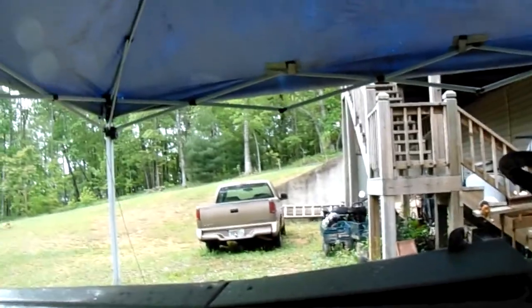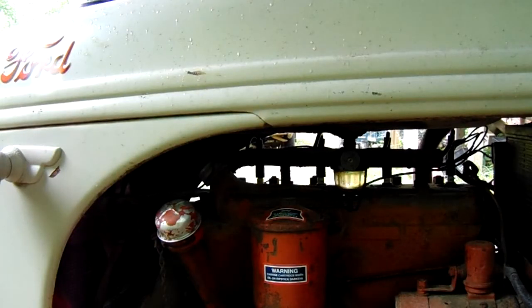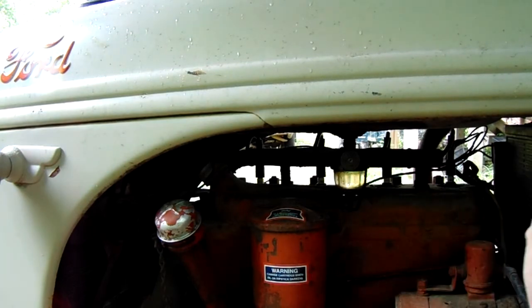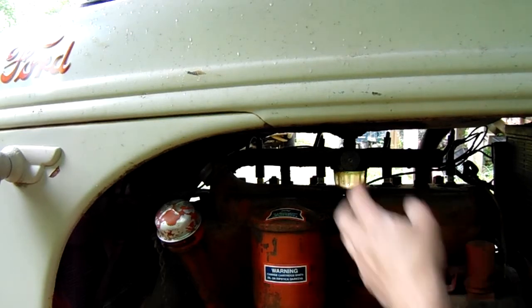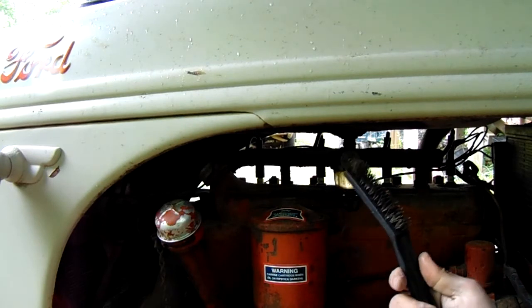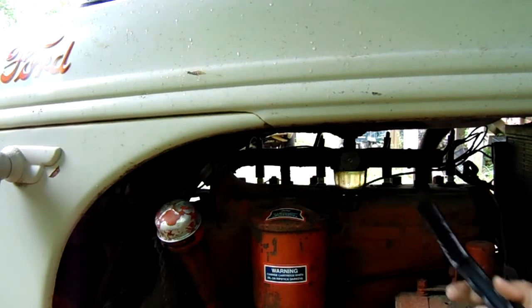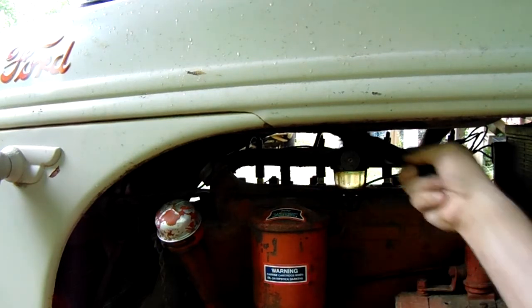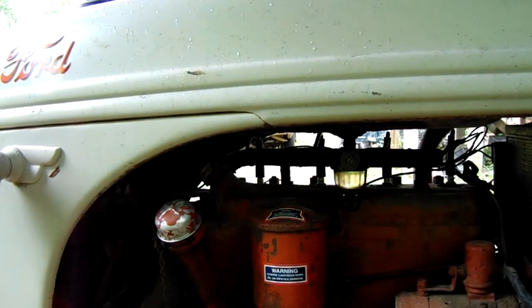Let's just get back on it. We got a bucket sitting under this thing to catch any gas, and we're going to have some gas come out of this. It protrudes up in the tank a little bit, and there's just no way to drain every last bit, even on reserve. So we got a bucket to catch the gas, and it's important that this is not the same bucket you caught your gas in that you're going to reuse, because we've cleaned with a brush here. We've cleaned all this area, got as much trash as we can. These tractors are old, and there's still a lot of trash here. We've cleaned this just to make sure we don't get trash back up in the tank when we put the new one in. But the point being, you're going to get some trash down this time, and this gas will just be to recycle.